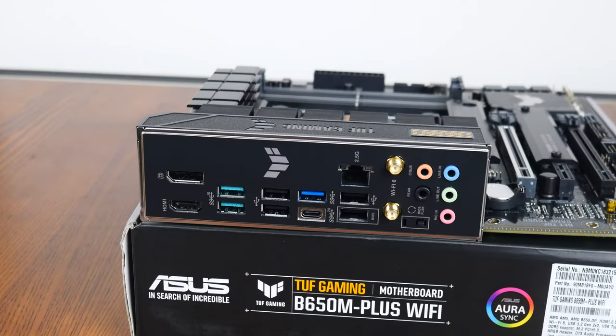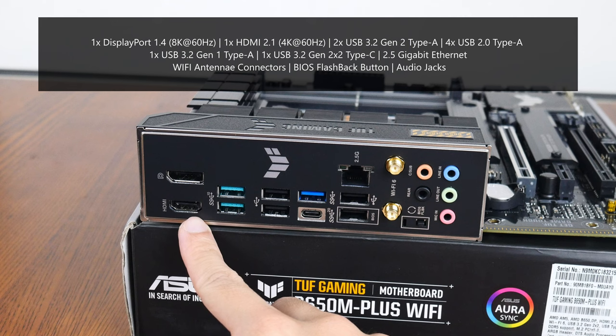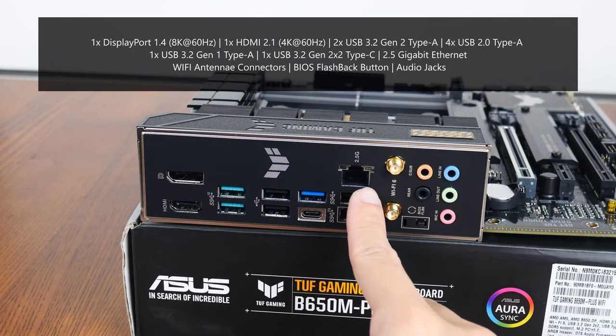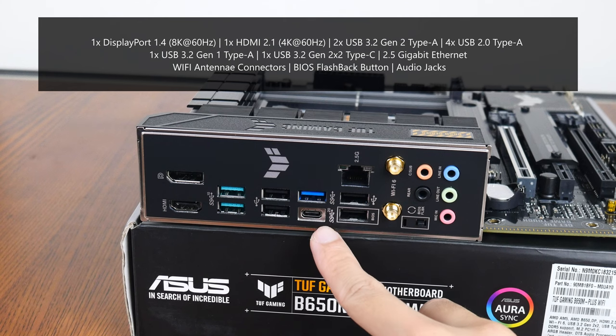Moving over to the rear I/O, the TUF Gaming B650M-PLUS WIFI goes for an integrated I/O shield design, and it comes with a DisplayPort 1.4 connector supporting display output of up to 8K resolution at 60Hz, a HDMI 2.1 port that supports display output of up to 4K resolution at 60Hz, 2 USB 3.2 Gen 2 Type-A ports, 4 USB 2.0 Type-A ports, with this port here supporting the BIOS flashback feature,